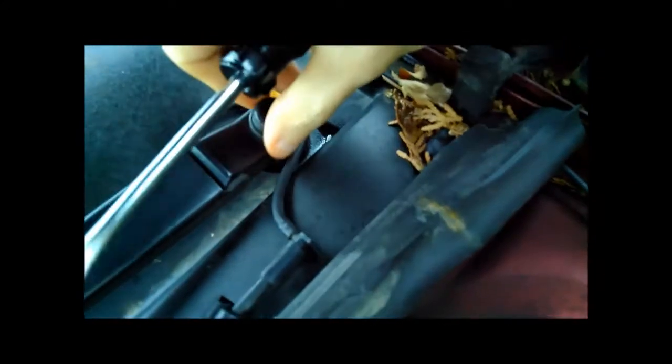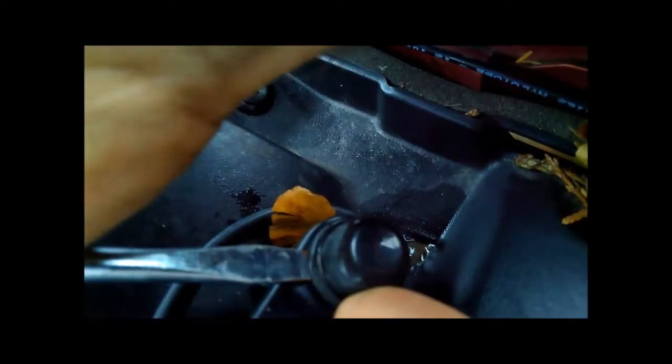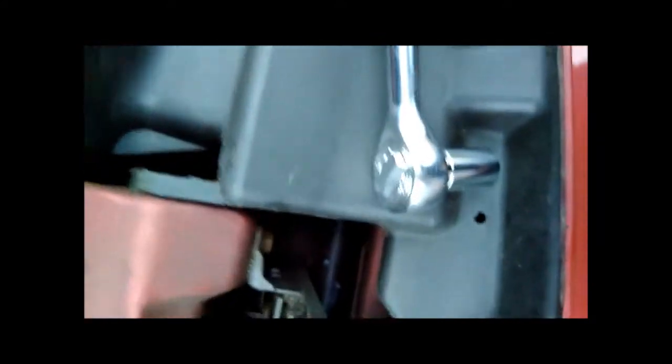You can see there's a little plastic cover, and you can't just pull it off — you have to jam something underneath it to pry it off. Basically there's just a nut underneath this cap, and it keeps the nut from rusting. Put that in a safe place, try not to lose it. Then go back and grab your 13mm socket wrench.